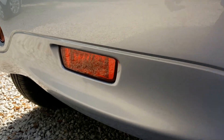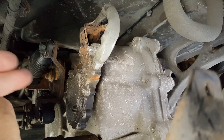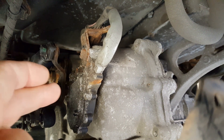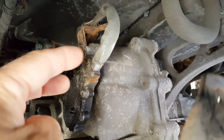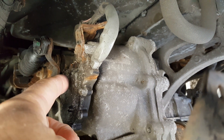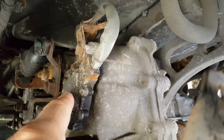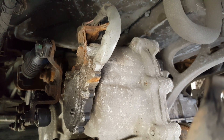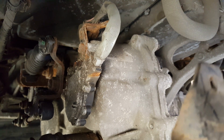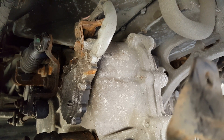Go round to the back of the car and look underneath. You'll see the linkage from your gear stick — the gear selector. There's a linkage here, and as it enters what I assume is the gear selector sensor — it has an electrical connection — it just needs lubricating. Get some spray and give it a really generous lubrication in there. Then work your gear stick up and down, back and forwards through all the gears, and you'll find it will free off and get much smoother.